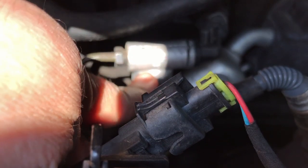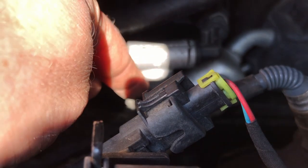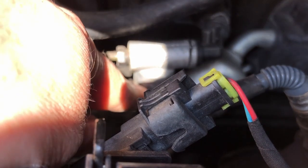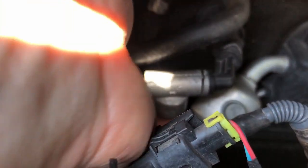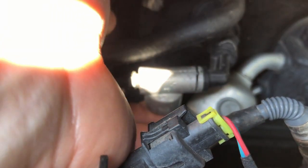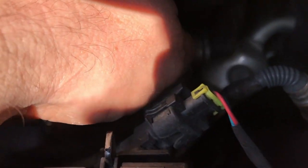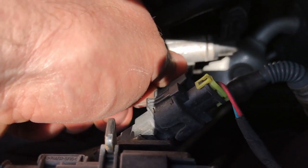But if these fail, what can happen is when you're pushing the fluid it pushes into the damper and you lose a lot of the fluid volume in the damper - you don't get as much fluid down to the slave, so you get a really low biting point. So that could have been what the problem was, because it has been a problem before on other Hyundais. But someone's put what looks like a sump plug in there - we've got a mirror in there and looked in it and there's a hex in there - someone's already done that. But the way the clutch feels, I can only explain how it feels, and it just feels really heavy on the bottom of its travel. And as I say, it doesn't look like it's actually been changed.